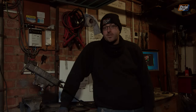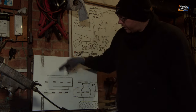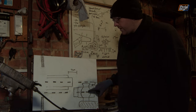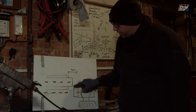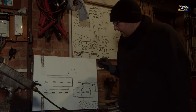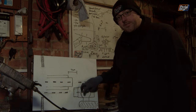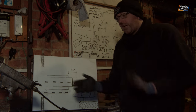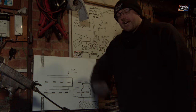Yesterday's success was pretty short-lived once I discovered the offset was too great to actually get all of the gears. The problem is fairly well demonstrated here: the Bowden tube comes through and has the cable in the centre, and this is the line up onto the pin on the bottom of the lever. The gear stick comes all the way down with this ball — this is the bushing housing that sits on the back. There's about a 10mm offset between the centre line of the hole I've drilled and the centre line of the ball bearing on this pivot.